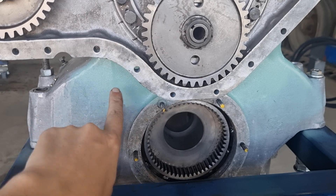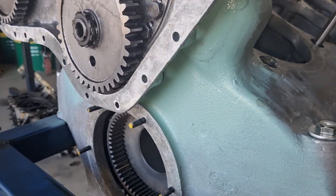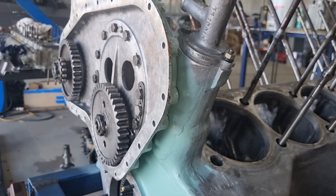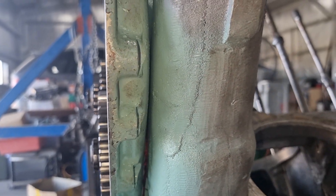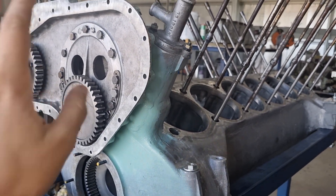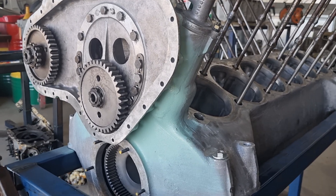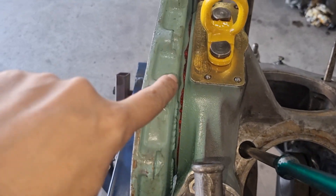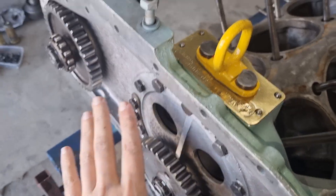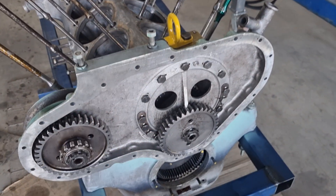Eagle-eyed viewers will notice that the engine is turning green — that is not because it's sick, we did paint it. It's unfortunately not the duck egg blue that we wanted, but we had to fit this pretty early on in the engine assembly line, so we've had to use some of the subpar paint just to paint these two surfaces, because it's pretty well impossible to do that when it's assembled as it is now. That's the only reason why the paint is on the engine at this stage. We have sealed it — all the red stuff is our anaerobic sealant. It's just metal on metal; it is an oil seal, so this is lubricated from the engine and it does have to be oil-tight. It's not high pressure, but still better safe than sorry.